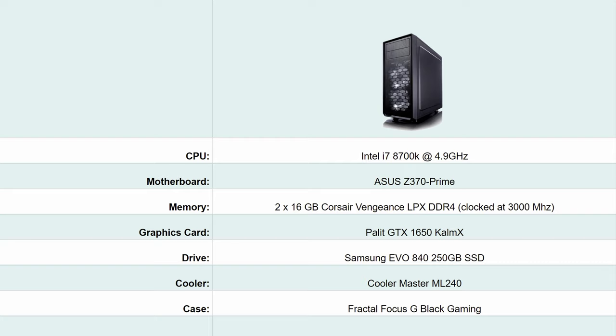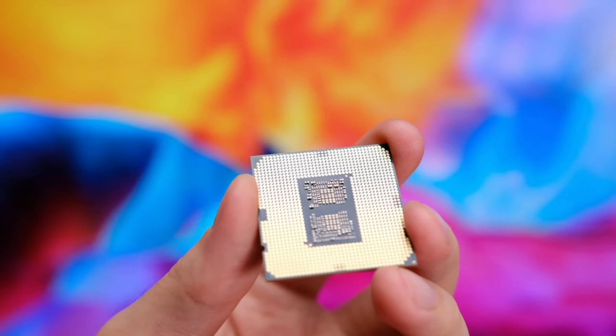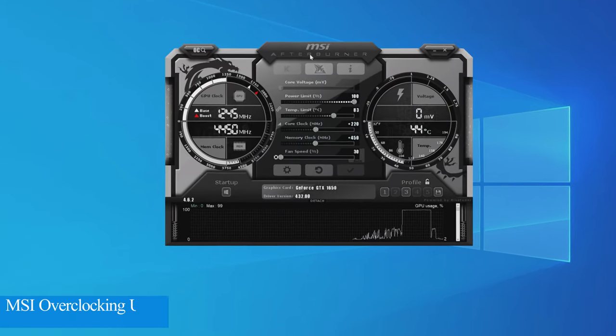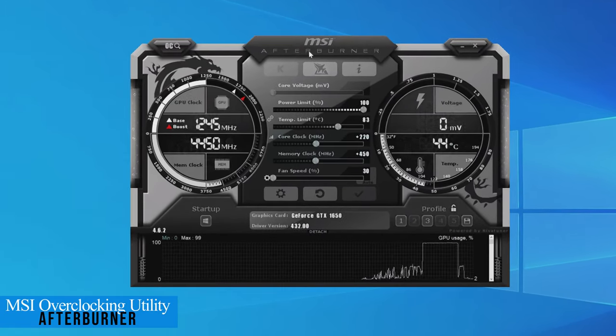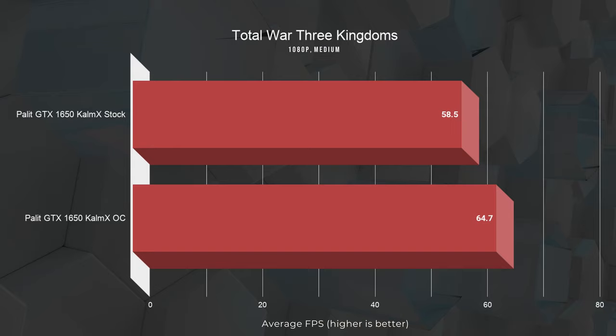Let's check out how it delivers. Our case has two front intake fans and one exhaust at the back, providing some airflow, with all fans set to low and completely inaudible. We're using a high-end CPU to eliminate bottlenecks and show the true maximum GPU performance. For overclocking, we used MSI Afterburner and pushed the core clock by 220 MHz and the memory clock by 450 MHz — we tried to push further but the card became unstable in some games, so we settled for this.